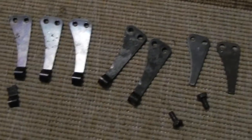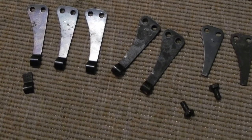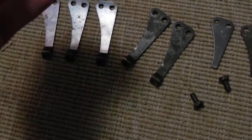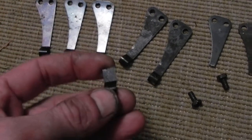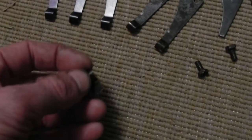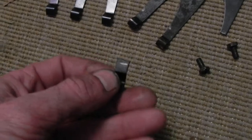On the ride yesterday we had stopped shifting the bike, got stuck in fourth eventually, and I thought that there were serious problems with the gearbox. I thought for sure I was going to have some serious gear problems because it's stuck in fourth. I've always been able to shift with a broken detent spring, always been able to move the cam plate. So I pulled this out and thanks to the magnetic drain plug, I was able to have this captured by that magnet and not float around the gearbox. And really this is the weak link in the gearbox of a BSA unit single.